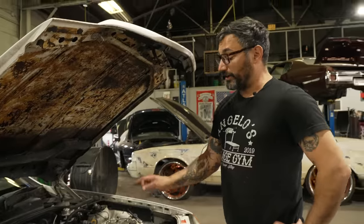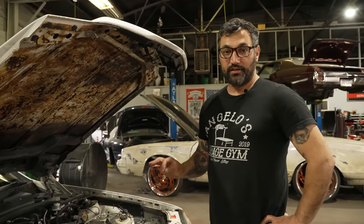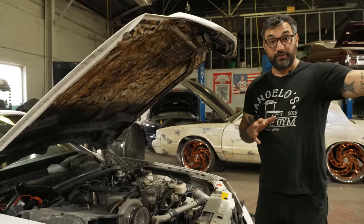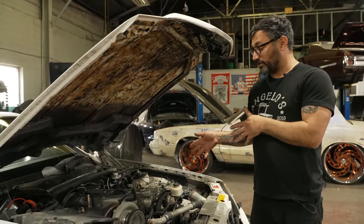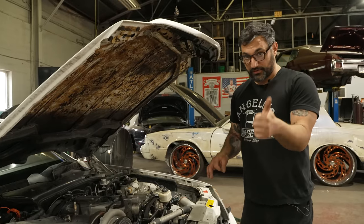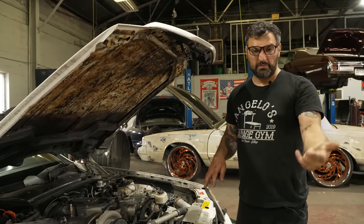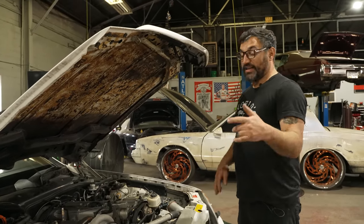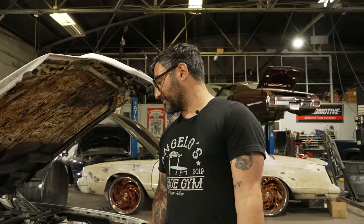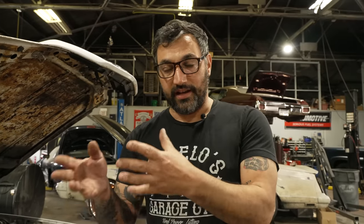These were brand new plugs, so that's a really good thing because they won't have been changed by the way we used to be running. They've basically just been on the car for the last 10-minute drive we took over here. I'll look at them and see if there are any marks from detonation, or if they look super foul from too much gas, any of those things. It'll give us an idea. Old school racers, especially drag race guys, pull out the plugs and look at them, even under a microscope, to really see what they're doing and how the engine is working inside the cylinder.